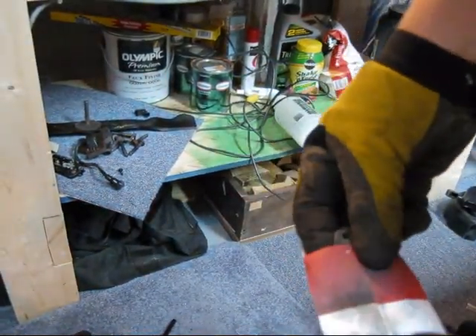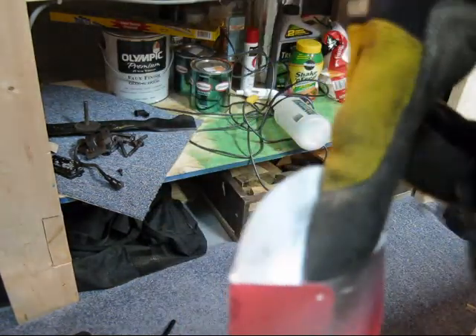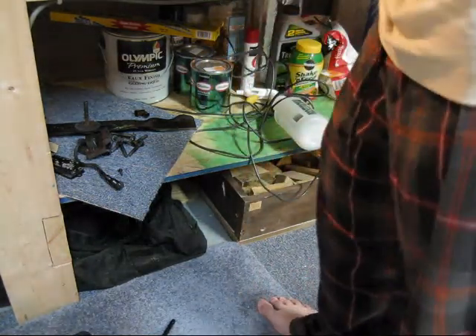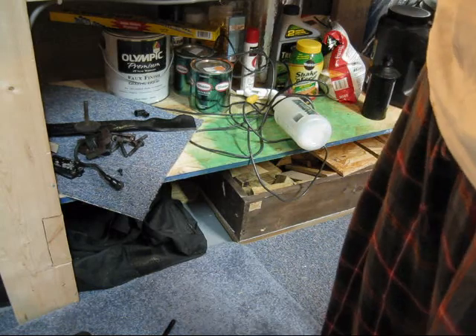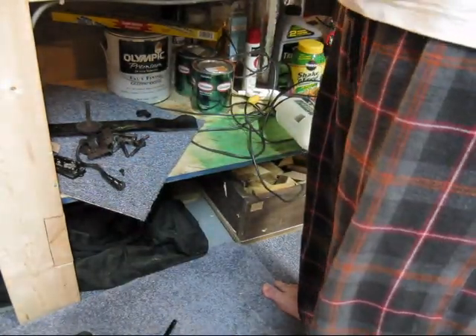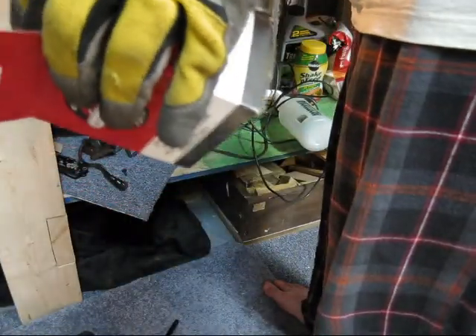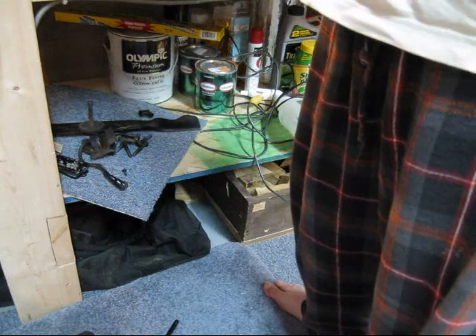I saved the parts that went to the gas can. This is a gasket, and there's some more gaskets which go to where it seals around the intake pipe. It's freaking plastic. Briggs and Stratton really need to stop making their carburetor out of plastic, because that's just not helping anybody out. That's the old carburetor. I kept all the parts I took off this thing, except for the old air filter. The carbon buildup on here — lord, there's so much carbon. I can't get over that.